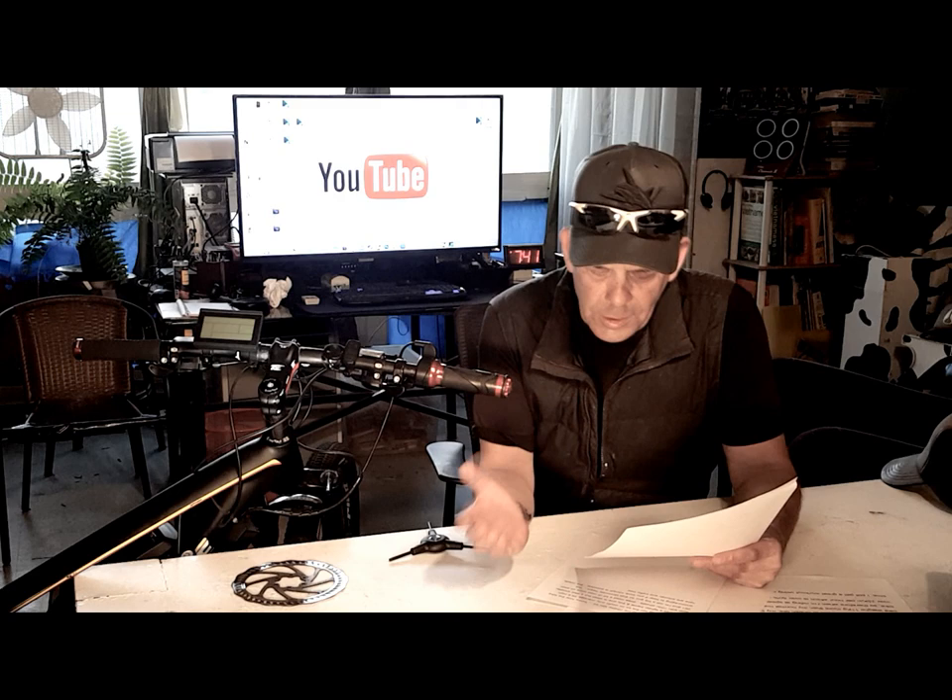From Canada: what does it mean if the battery level is blank, showing no bars, but the actual battery is full? We sent back that actually your LCD is not connected correctly. So he connected it in, and of course he got his full display.